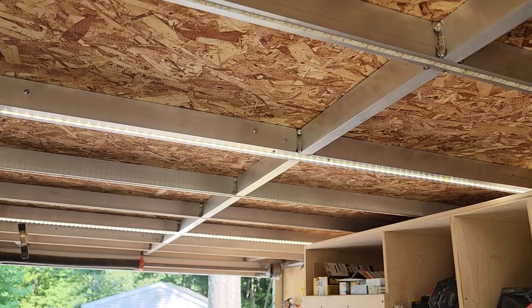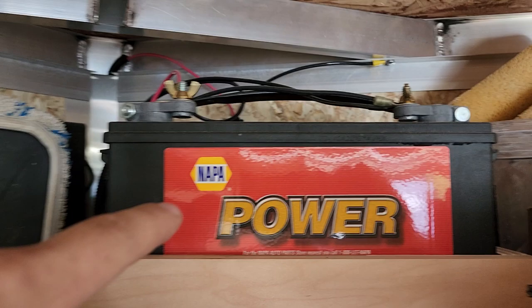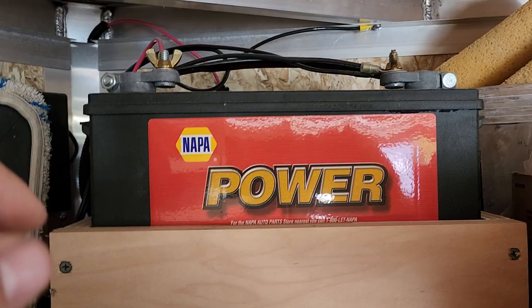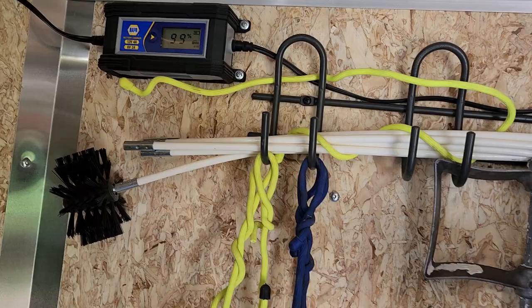This controls those three light strips — one, two, and three. It's not plugged into the truck right now, so what I did is that wire goes across, behind the plywood, and comes out right here, connected to a deep cycle marine battery — basically a big car battery — connected to that so the battery power only runs these three light strips. To charge that battery, I have a regular car charger across here. It's at 99% right now. When the trailer is plugged in it automatically charges that battery, and it will also trickle charge off the truck, so I don't think I'll ever have to worry about it.